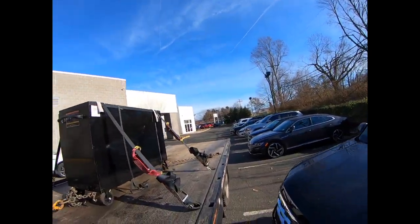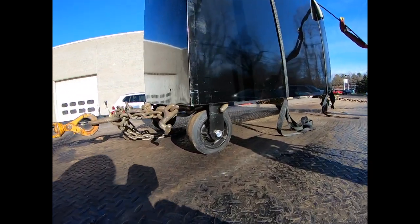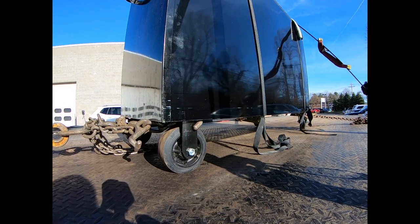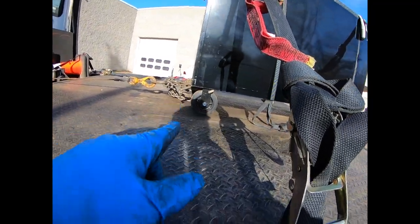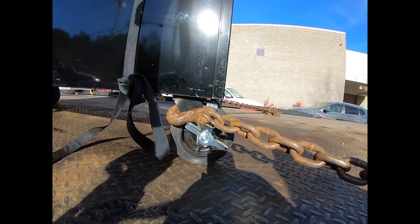Okay, so from the beginning, sorry about the stiffness, it's cold out. Insert the mini J's like that, so that when it pulls in, you see how they're pulling in, it'll stay hooked, it won't disconnect. Sometimes you do it the other way, they will. So the bridle is shortened out like that, and then the grab hooks go on the back wheels.